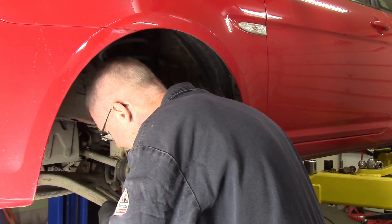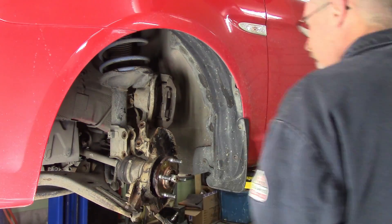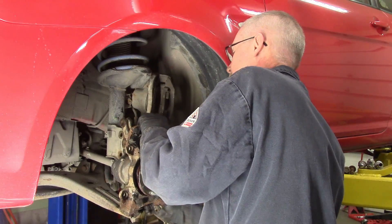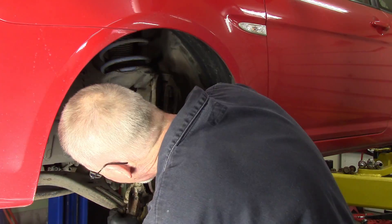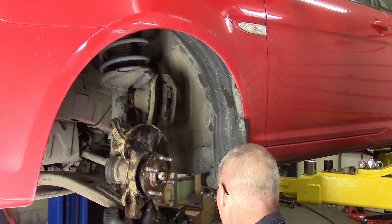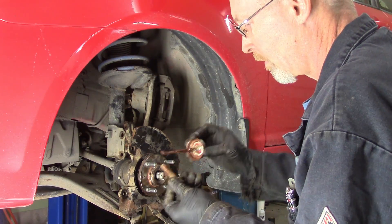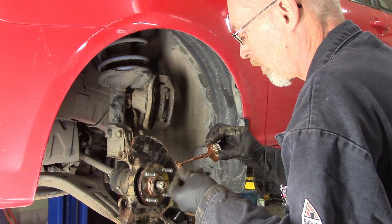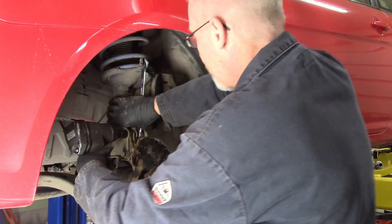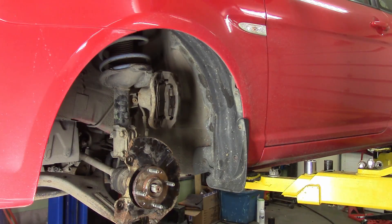I never-seize the snot out of everything because who knows, I might be in here again. I remember doing wheel bearings repeatedly on — golly — a first-gen Honda Civic that I had, went through a bunch of those. Either I suck at putting them together or I was buying pretty cheap bearings. But these are Timken, so it should be pretty good. A little awkward getting these bolts in, but they went in. I gambled on not having to do an alignment, but there was enough of a change that I'm gonna have to. The only thing that's adjustable is toe, so that's okay.